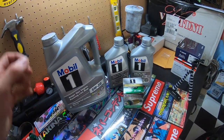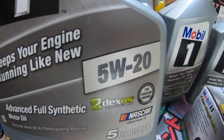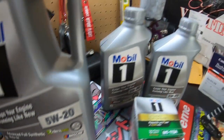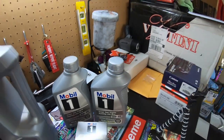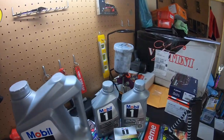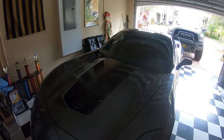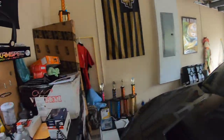This is what we're going to need: 5W-20 — this is five quarts — and then we've got two other quarts here, because the 5.7-liter Hemi takes seven quarts. I'm going to use Mobil 1 because it's my preference — I use Mobil 1 in the Vette, so I'm going to put it in the truck as well.